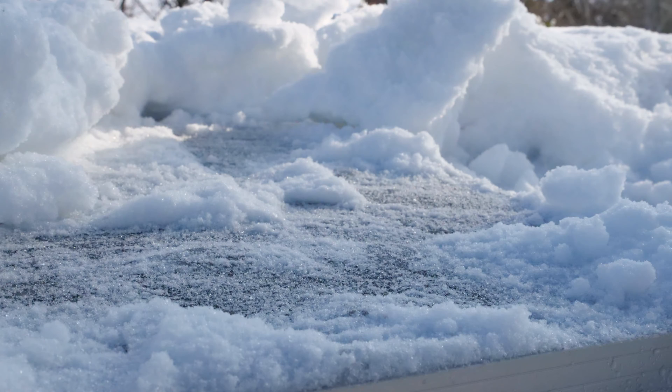Now let's fast-forward to winter. The sun is super low in the sky, barely high enough to hit the solar panels — and that's if they aren't covered in frost, snow, or ice. I said in a previous review I wish Bougie RV or somebody would come up with heated solar panels so you don't have to climb up on your roof and clear the snow and ice. The other issue is that permanently mounted panels are flat — not positionable. A lot of people build ramps to incline their panels to take advantage of that low winter sun, and a solar blanket is perfect for that.